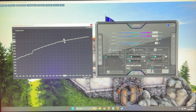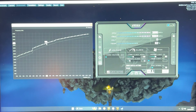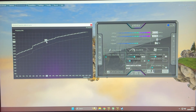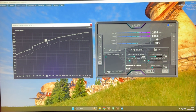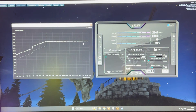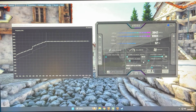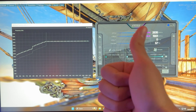Click on Curve Editor and pull up the curve. The first preset retains average performance, which tops out at around 2,900 MHz. To retain that, grab the 925 mV voltage point, hold Shift and bring it all the way up to match stock performance. I recommend staying a little bit under stock — for example, if stock is 2,895, target around 2,850. Once set, click on the curve, hold Shift, select the rightmost part and flatten it out. Hit apply. I still recommend unlocking your power limit to avoid hitting it during spikes, and give it plus 1,000 on the memory for free performance.